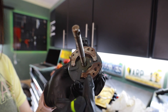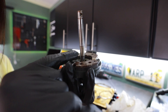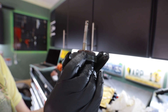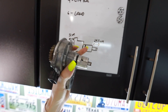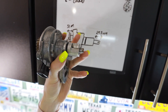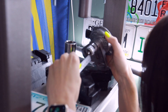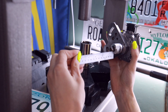Before this goes back in there I did a visual inspection. If you see right here on the shaft, there's actually a little wear mark scored into it — I believe the bearing and seal sit somewhere in this area, so that's a little worrisome. And if you look right here, the magnet on this side is cracked, so that might be an issue. You probably noticed at the beginning of the video the weird sketch I had on my dry erase board — there was a purpose for that. This measurement right here is how much the shaft is supposed to stick out in the front. You have to press it into place and make sure it's 29.5 millimeters from this front surface to the very tip of the shaft. Go go hydraulic press.